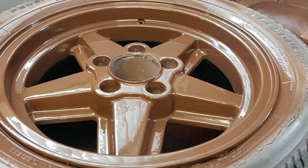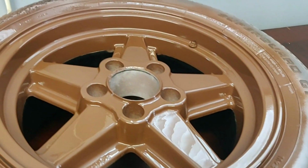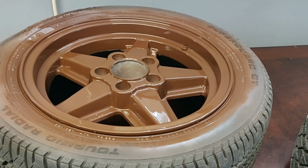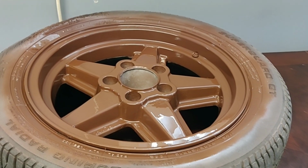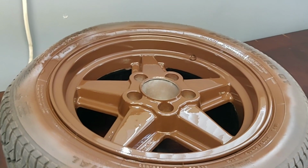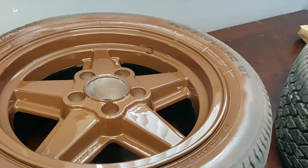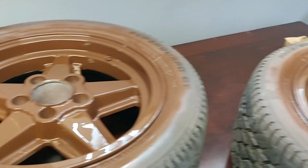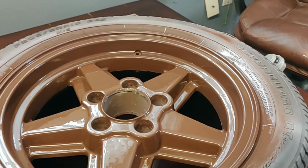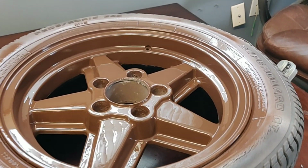So I wanted to go ahead and do a quick fill-in, because if you're like me on these type of videos, you skip to the end because you really want to see the outcome, and sometimes you miss some of the important things. Now, the way that I do this is I do a light coat with about a 10-minute time between the next coat. Then I put on that really heavy wet coat that you guys saw, where I kind of hit some of the areas that need more paint a little bit more, dusting it and getting it really wet. Then I let it sit for about another 15 to 20 minutes and I apply another coat.